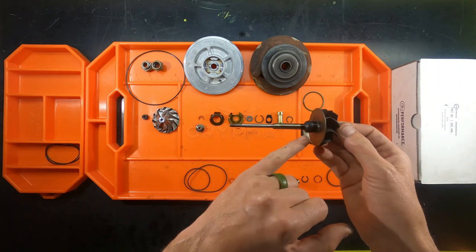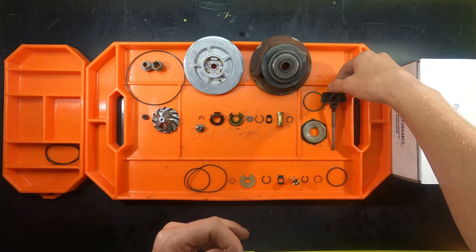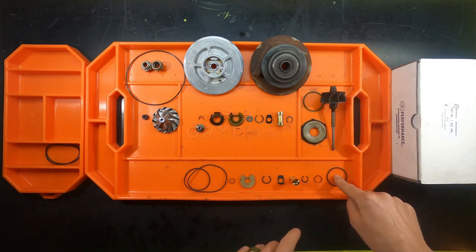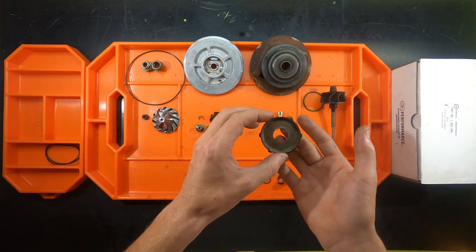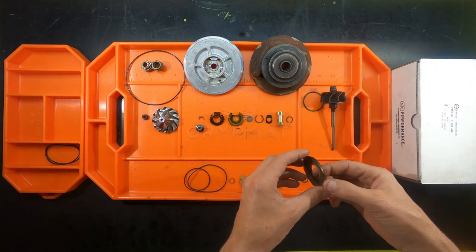On the turbine wheel, there is this piston ring or sealing ring. Make sure that you put the new one on the new shaft before you reinstall that. It's probably one of the first steps you want to do. And that is this piece right here. And then obviously you've got this O-ring that's been replaced. And this rotating assembly, I think it's an oil seal of some kind, just helps prevent friction building up on the inside of the turbine wheel.